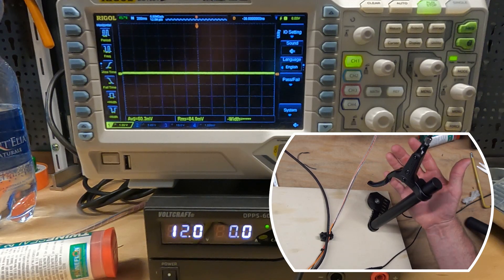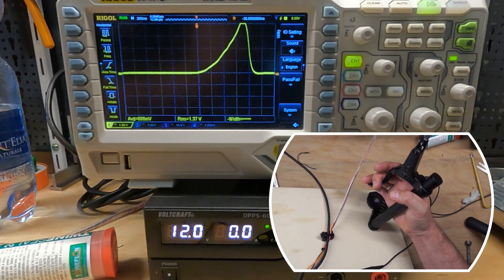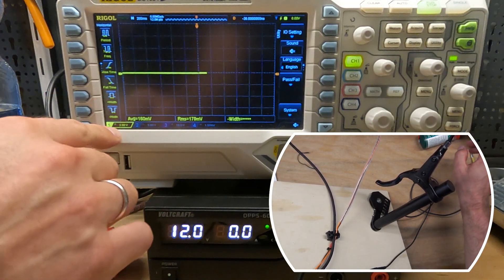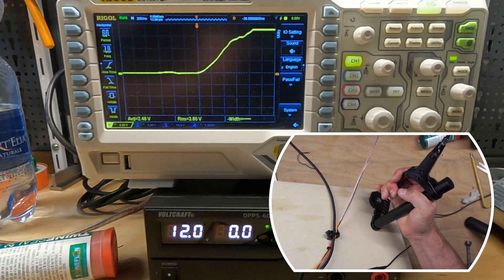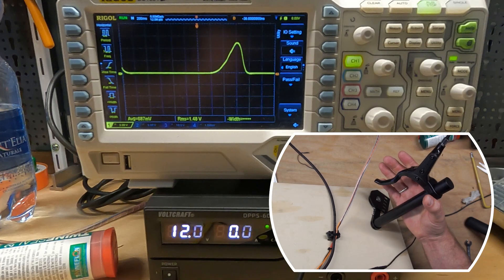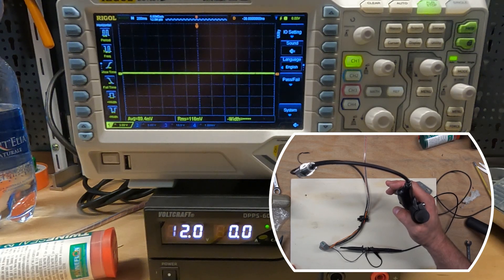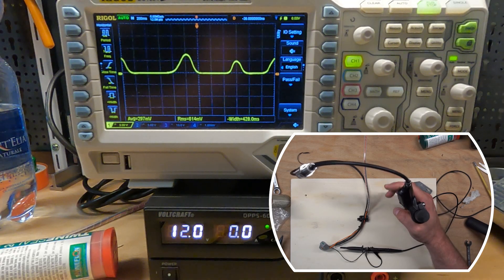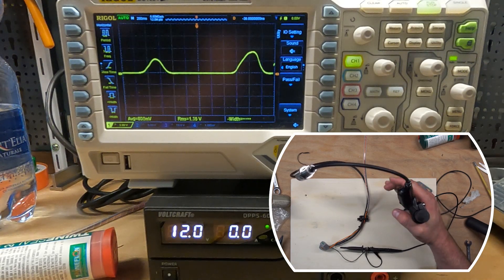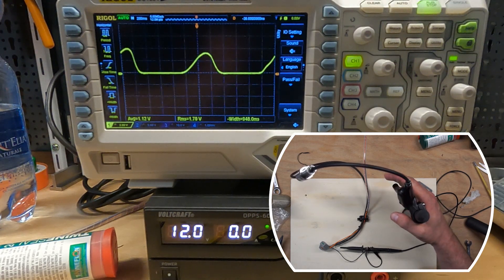The level of recuperation is controlled by on or off. Here we have an analog input, so we can control it proportionally. Right now it is two volts — let's see the maximum pressure. At five volts, the maximum pressure is 40 bar. We probably have higher pressure in our system, so this lever can create more. But in our opinion, we don't need that much pressure, because after a certain point we have a fully applied brake and we don't need any recuperation. This will be just the maximum recuperation to help the brake system stop the heavy e-bike.